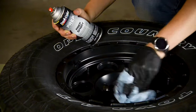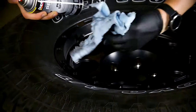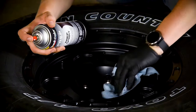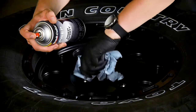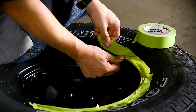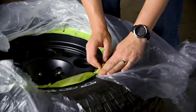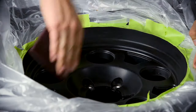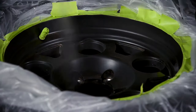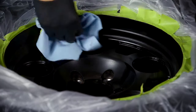The first step is to prepare the surface by removing loose paint, dirt, rust, grease, and wax using a grease and wax remover or prep spray to lightly clean the surface. Next, you want to mask off your surrounding area to protect from overspray. Lightly sand the surface with 320 grit sandpaper or a scuff pad. Wipe down the surface again with the grease and wax remover prep spray. Now your surface is ready to paint.